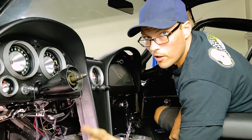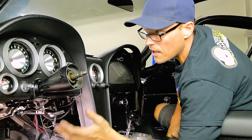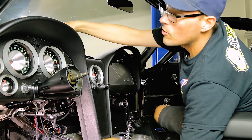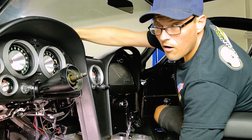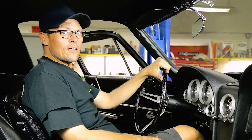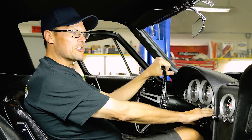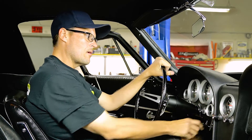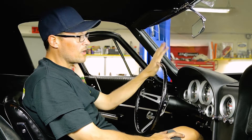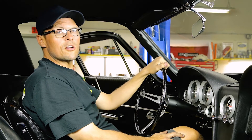Now that we've got everything hooked up, we're going to go ahead and tidy up all the wires, making sure that they're free of any obstruction. Reassemble the underneath of the dash, reinstall the steering wheel. Then we're going to move to the outside of the car and put the firewall plate on for good and hook the power up. We've went ahead and reinstalled everything, hooked the battery up. We're going to give it ignition hot — wait for the click. We have the click. We're going to go ahead and take this for a test drive, clock the steering wheel. And thank you for watching our videos.